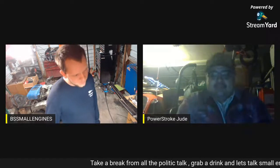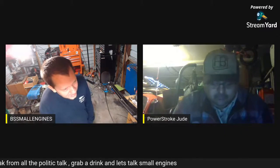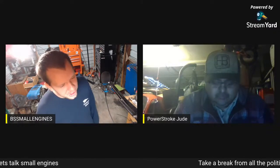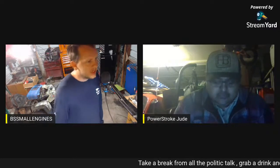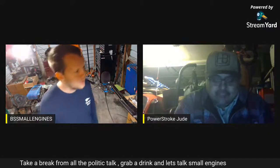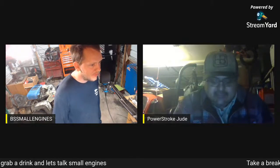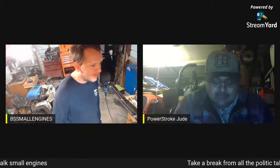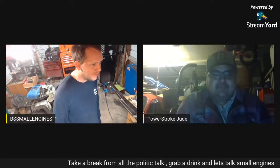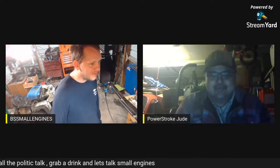Yeah. Joe Smith says the problem he had with the 6.0 was the head gaskets and stuff. But yeah, that's usually the one thing that happened a lot in the shop, the bulletproof kit. They redid all that, put studs in there and stuff like that. Read Sergeant Joe Smith's whole last post. It wasn't just the turbo. He said the only problems were the turbo, head gaskets, injectors, oil cooler. Otherwise, it's the greatest motor ever. Yeah, but once you get all that stuff taken care of, it is a great motor. Yep.